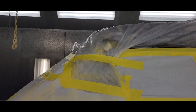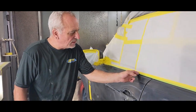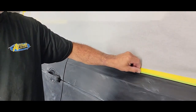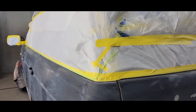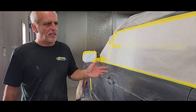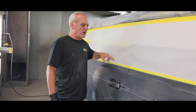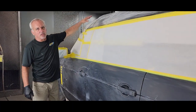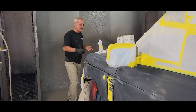I wanted to go back to the video I did yesterday and show you guys something. This is the green tape I was talking about that I outlined last. If you notice, this is one piece. You go back here and there's my tail. So I know when it's done, what I do is go ahead and pull this off — one piece, continuous. Try to avoid doing two or more pieces because it's a pain. You don't have to worry about the clear coat bridging on the edge of the tape. I did that to the windshield, and also my tip about the sunroof — the sunroof was cracked open. Go back and see my other video that I did yesterday.